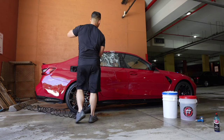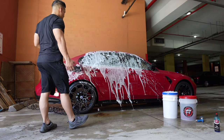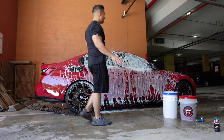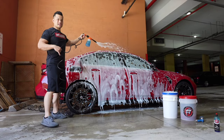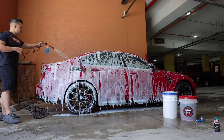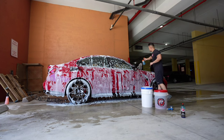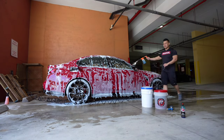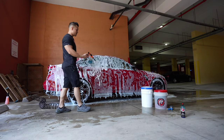We're going to foam it up, and the reason why you want to foam it up is because it provides another layer of lubrication onto the paint. This is probably not the most ideal setup but it's better than nothing. When I get the car fully PPF'd this may not be the most important step, because PPF does take a lot to scratch — those micro scratches are going to be almost impossible to cause. But right now this portion of the step just provides another layer of lubrication so you're not putting a dry mitt onto the paint, and whatever debris or road grime hopefully gets trapped in the suds and brought back down.